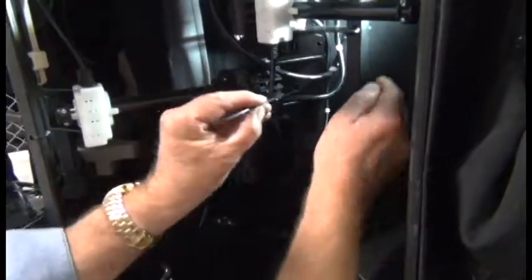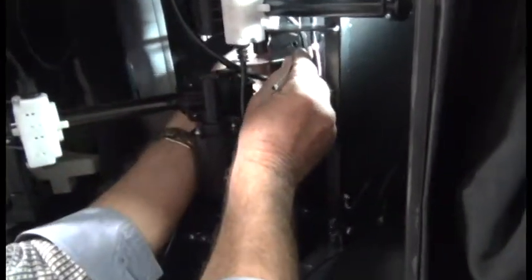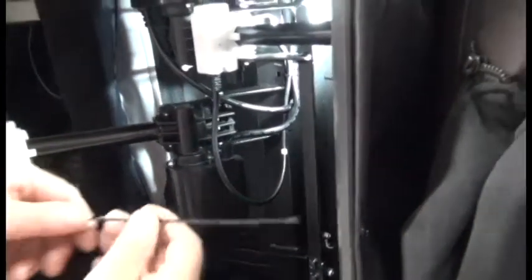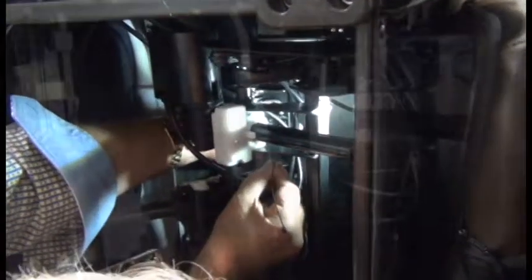After the actuator is installed, then we need to secure the cabling using new zip ties in the same locations they were secured previously. It's easy to remember where those were because for 3 of them, there are holes in the chair frame for the zip ties. So from the actuator, follow the cabling upward and you'll find holes along the frame for the first 3. For the 4th zip tie then, there isn't a hole in the chair frame, but simply secure the cables using a zip tie wrapped around the chair frame.